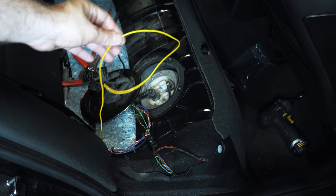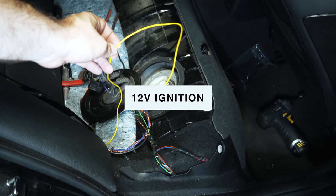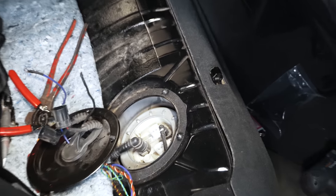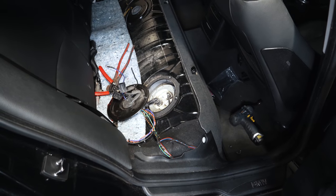This is the switched signal wire for the relay. I'm going to pull that back through into the trunk compartment area and find a place to tap in that's only active when the ignition's on. I'm pretty much finished up with the electrical side here — it's just going to be the fuel pump installation, so I'm moving to the trunk area now.